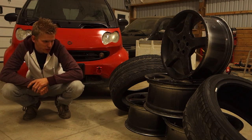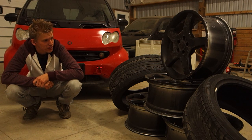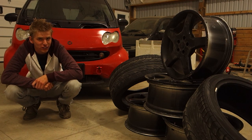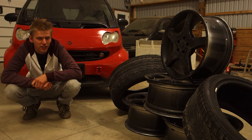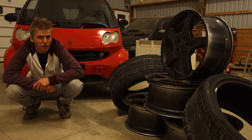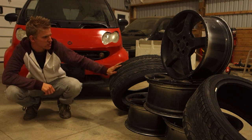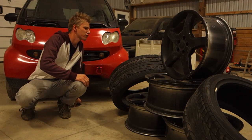I've been looking for deals — this is a budget build. We found a set of 19-inch rims, eight and a half inches wide, and Chris also found a set of 255/40/19 tires. These barely fit on the car but we're going to make them fit. 17 was our preferred rim size, but we found a set of 19s for $120 — they're AMG replicas. We're sticking to the Mercedes style for the wheels, and we've got a set of adapters on the way from Smart Madness.